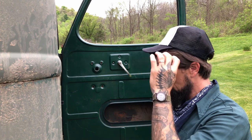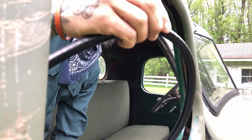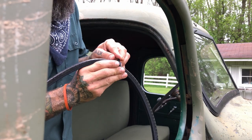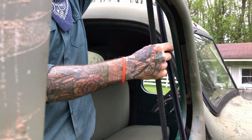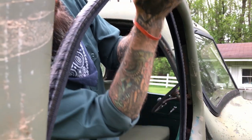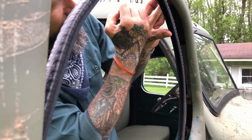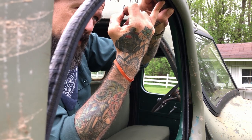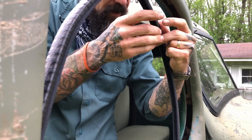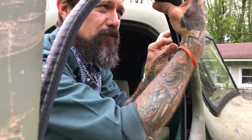We've also got the felts. First things first, we have to run the channel through. We start at the top — match up the two ends and find the very top middle. In these doors on the bigger trucks there are three holes right at the top. Sometimes new holes have been drilled, so I just use them all. I put a marker clip to let me know the exact middle point, then feed this down through the door and pop it in.